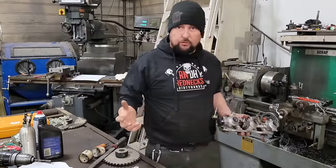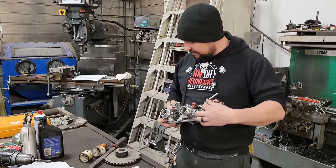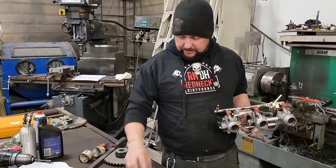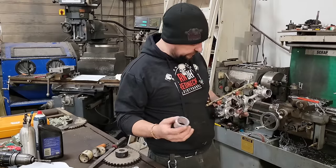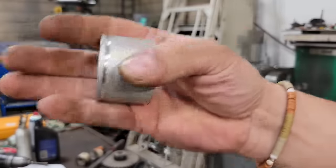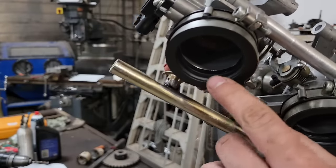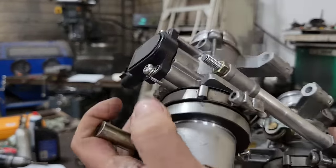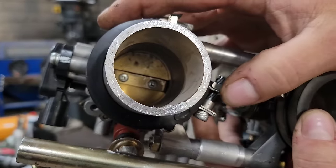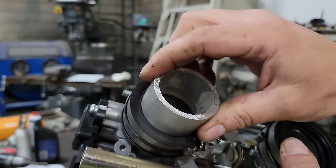We're over here in JP's machining corner. Without these tools there's no way I'd be able to do any of this — thanks JP. I've got some aluminum tubing and I've been playing around. This two-inch tubing fits perfectly inside these guys here. I just take the tube, cut a groove in there which coincides with a little lip inside these things. Once you machine that in there, it's nice and tight. Then I'll turn them down a little bit in the lathe too, just so I can squeeze those clamps a little tighter — that way they'll be nice and locked in, won't blow out.